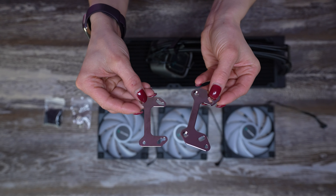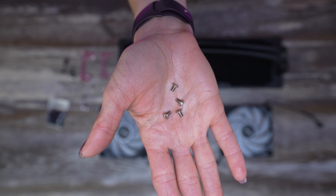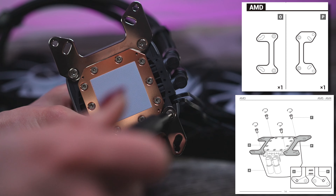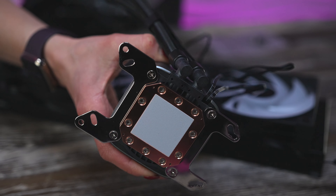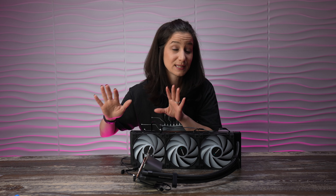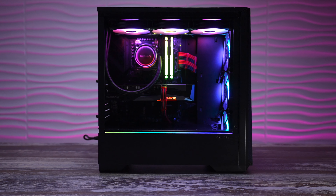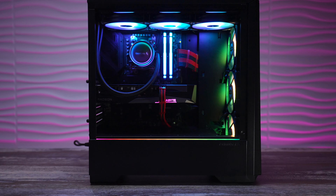Now you're going to take your long screws and secure the fans in place directly onto the radiator. Next, we attach our two shiny brackets with the little baby screws. The brackets are not exactly the same size, so you want to make sure that you double-check the manual for positioning as you follow along here. So now that this AIO is all set to go, we're going to move it to the side in a safe spot while we work on taking the old one out. And if you don't have an AIO installed, you can skip to the next section.